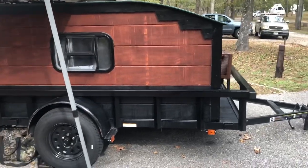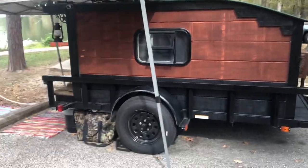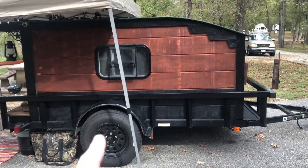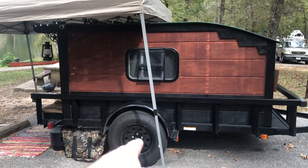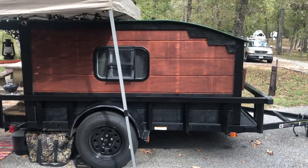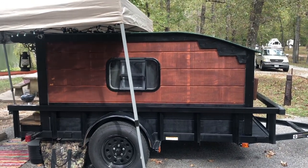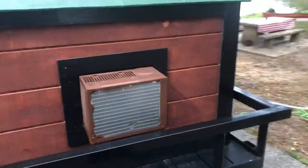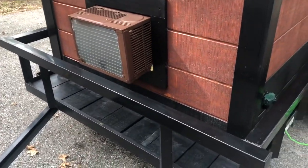As you can see, this time I went with the 5.5 by 10 foot trailer from Tractor Supply. When I first built it, I didn't like the looks of it because it just looked like a box on a trailer. So I came in and painted that bottom section where the rails are. That camouflaged it real good. I painted the wheels black also, so that gave it a whole lot better look. I used T111 on the side, turned it sideways, and the top is a stain and waterproof.